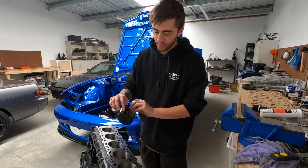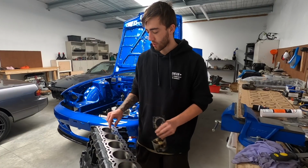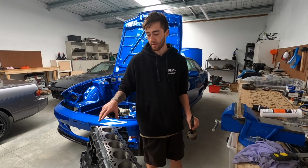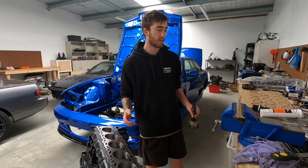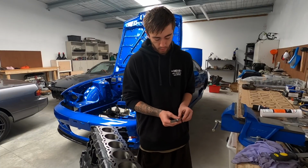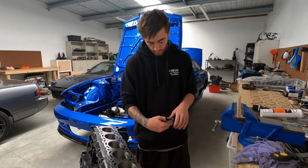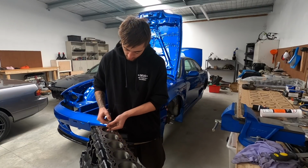This piston still has the old rings on it, which sits against the bore. Definitely make sure that that ring is sitting in the bore nice and flush, not wonky, which could give us an incorrect reading on the gap. So then go here, it's still 19 thou, so I've got to find the 23. So now we go in, put that in there.